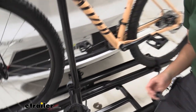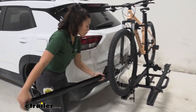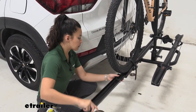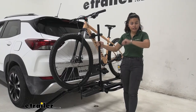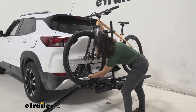There's an attachment point on the rack itself for the ramp. Before we take our bike off, we'll set up the ramp. There's a knob here — grab the ramp on this side, lift it up out of its bolt, and you can choose whichever side you want to put this on, whichever is easier for you. It just pops in, pops down, and you're ready to go.